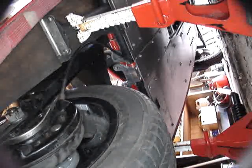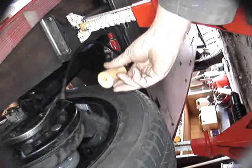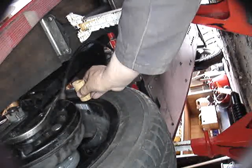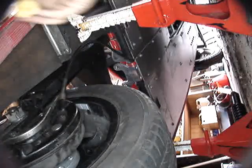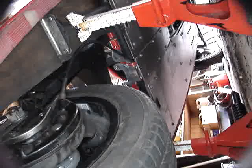Having lined the wheel up with the center line of the vehicle, you might like to make a little wooden block — a piece sawn off the end of a broomstick will do quite adequately, as long as the ends are nice and square, and it ends up being a snug fit between the rim and the edge of the swinging arm. You can then use that as a gauge any time you move the rear wheel to adjust the belt or chain, such as after a puncture, and it will get your wheel lined up with the center line of the vehicle.